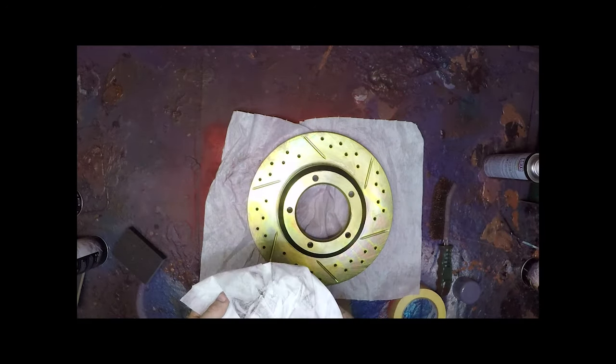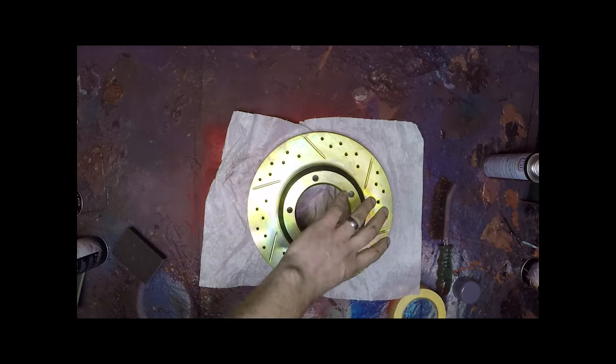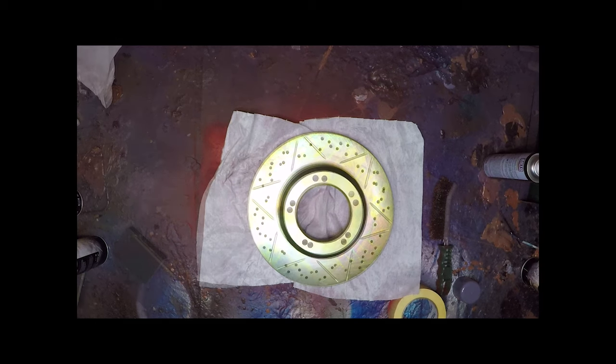Now you always wipe off contamination first, because if you abrade and prepare the entire area first and then you basically try and clean down afterwards, you do end up basically through your preparation pushing some of that contamination into the metal underneath. It's harder to get a good finish, so you're better off removing contamination first, preparing afterwards.